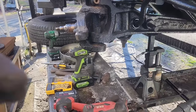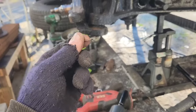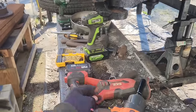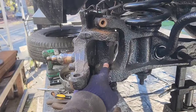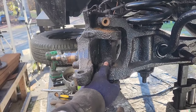Let's learn some rust belt mechanic tricks, shall we? Cotter pins in the rust belt will always be stuck. So what every rust belt mechanic has is a drill bit set that they don't care about. And we just drill sideways into the cotter pin, we snap them off, and then we try to get the nut off.